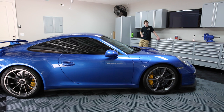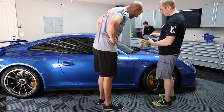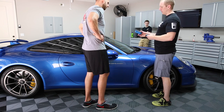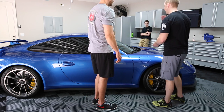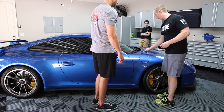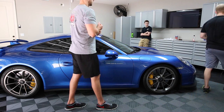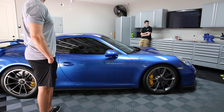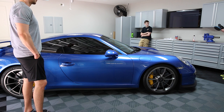Auto scrub is this — it's a little piece of rubber and there are little raised diamonds on here. You put this on the machine and it orbits. You can also use it with a pad and just work it out, or use a piece of clay that does the same thing. The key is it bonds specifically with the clear coat and just pulls everything off. But this is what will create a little bit of marring in the paint no matter how much you try not to. Most of it won't be visible though, so it'll be fine. We're going to use this on setting two.